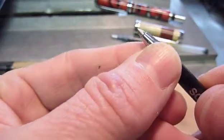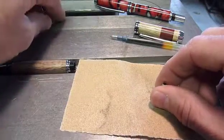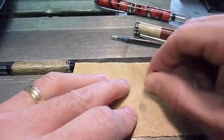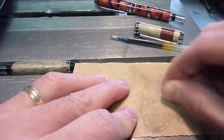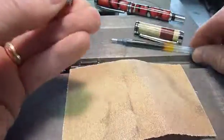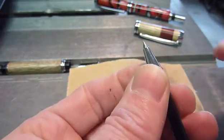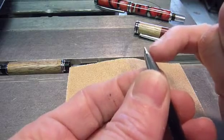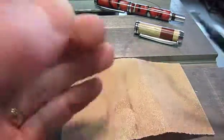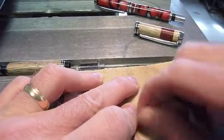You can't really use the original insert as a measurement, because as soon as you start sanding, the G2 is going to stick out further and further and stick out too far. So when you modify the kit, you can no longer use the insert that came with it — you have to use a G2. Let me keep sanding a little more. And then check it. Now it's starting to look pretty good — it's sticking out pretty good. You want it to come out so you can see the sloped part, but also see a straight part as well. It's not quite good enough, so I'm going to go ahead and sand it a little more.